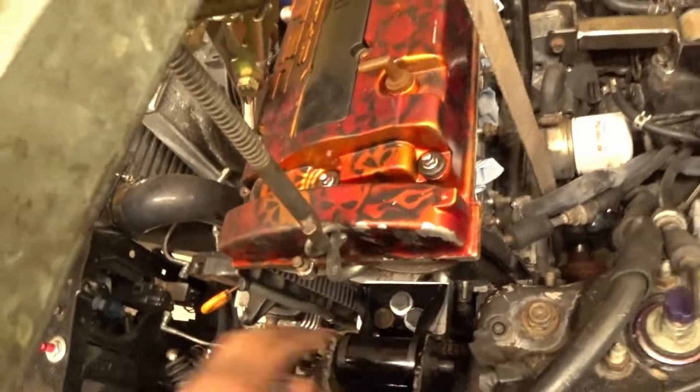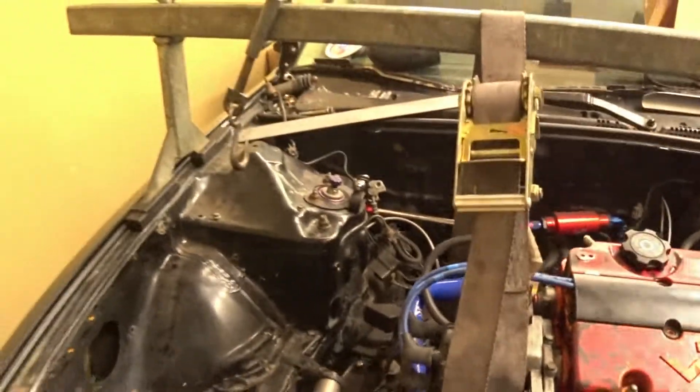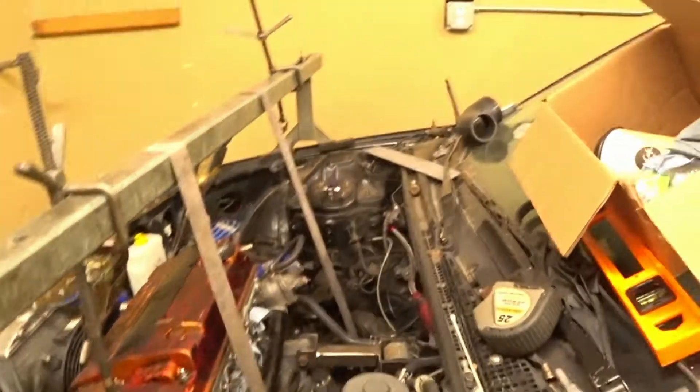Here's the mount that we made — everything's in place, it bolts up. That's the mount we're working on for the back, and that's the front. The transmission side we're going to work on tomorrow. More or less the motor is level, flat, stable — we made sure of that. We've got fairly good clearance for the axles. Tomorrow we're going to be doing the other side, the transmission mount, and then that's it. Once that's done, it will be suspended by its own power.